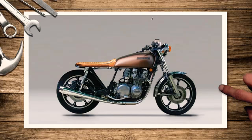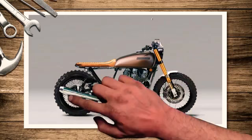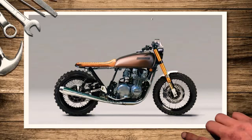The wheels are definitely something that you're going to want to change. You're not going to be able to go through any mountains or any terrain with these standard stock wheels. So let's take the two off and the front forks as well. We'll put on these lovely wheels and front forks - actually, that's from Triumph's new range. Triumph have a new range of bikes and one of them is quite scrambler in the way it looks. If you can afford forks like this, brilliant - if not, then dig around. You might find some motocross or trails bikes with short enough forks. Just be aware that front forks on motocross tend to be a bit longer than your normal scrambler or street bike, so be careful with your measurements.